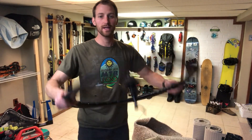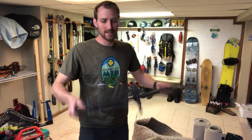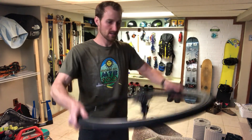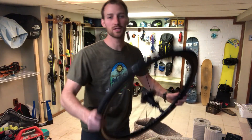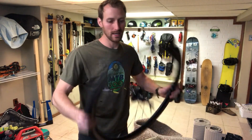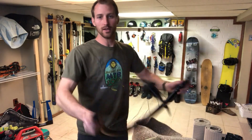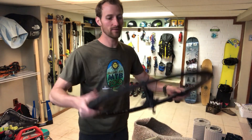Once you get that on, inflate your tire. Once partially or totally inflated, shake it up to get that sealant all over the place. When inflating, you want to seat your tire in the wheel — in the channels on the sides. I do it the lazy way: I take the stem out of the Presta valve with a tool like this, then use the air compressor regulated down to about 100 psi. Not recommended by any tire company — don't do that. After you get the tire seated, put the valve stem back in and hand inflate the rest of the way to whatever pressure you like to ride at.